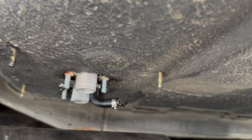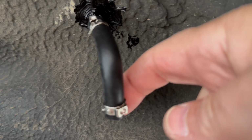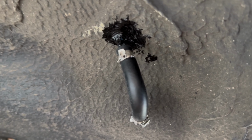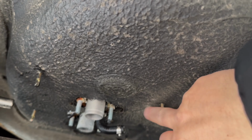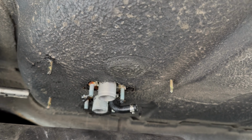Because of the fuel lines all coming through here as well, which seems like a crazy thing to do anyway, I bought some Webasto 90-degree bends, which makes life a bit easier, and some proper crimp fuel clips, which you basically use these jobbies to put together, and they're way better than any universal joint Jubilee clips. So that is what I'm using on here. So I'm just going to trim off these four coach screws going through, and then I'm going to start looking to see how the heat shield goes.